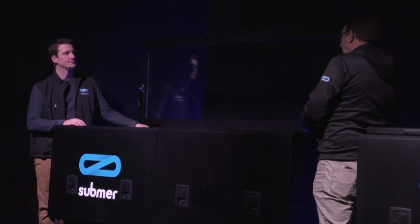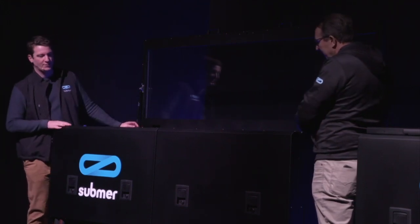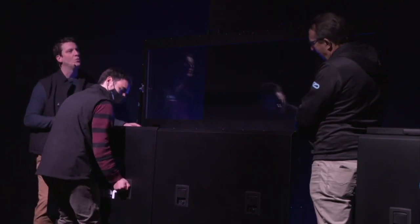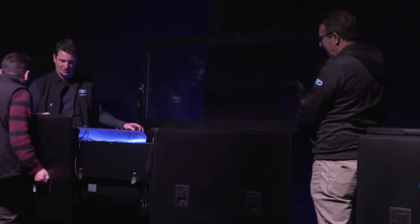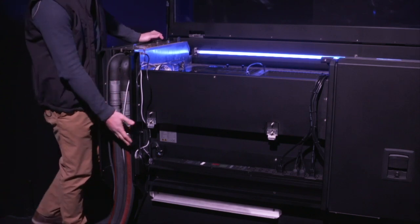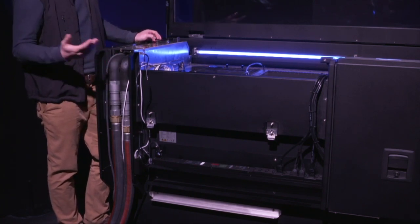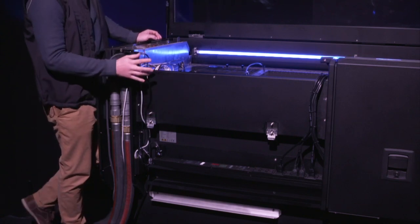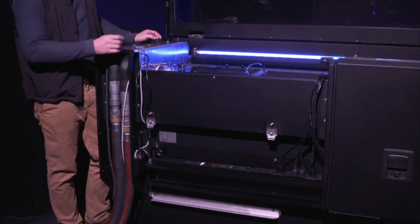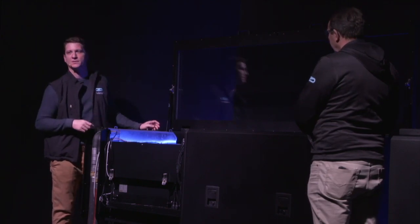Now we've talked about the inside of the tank — let's go to the dry zone, to the outside. Edgar, if you can help me remove the lid. The dry zone is designed to host the components that we don't want to submerge in the tank. The dry zone will typically host power distribution units — the typical APC power distribution units you'd have at the back of a rack — deployed outside the tank because they don't practically generate any heat. In this area we'll also have accessories for cable management and switches. Networking gear can also be deployed inside the tank because copper and fiber optics are fully compatible.